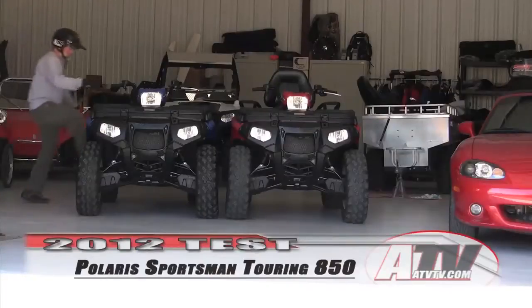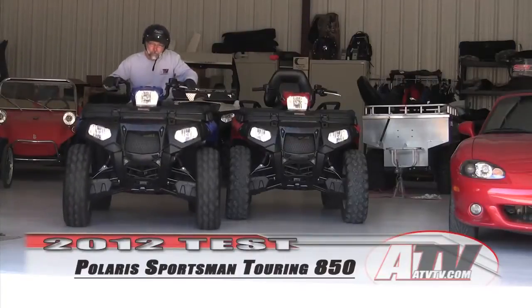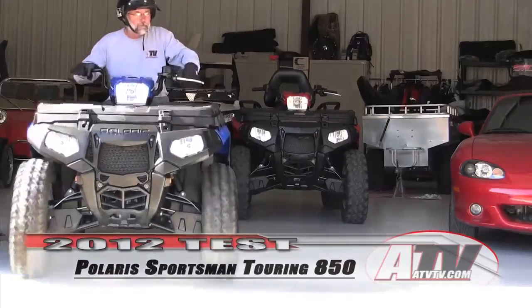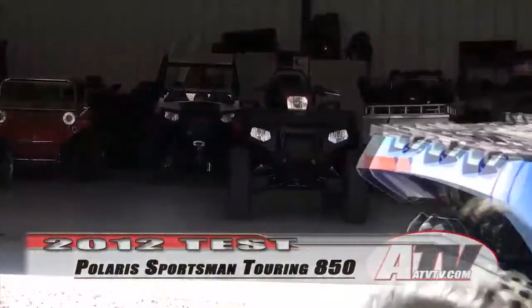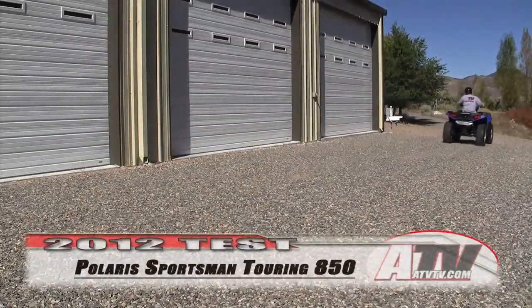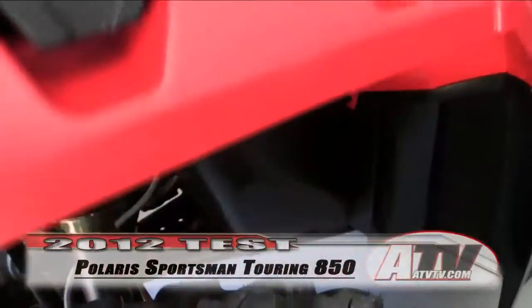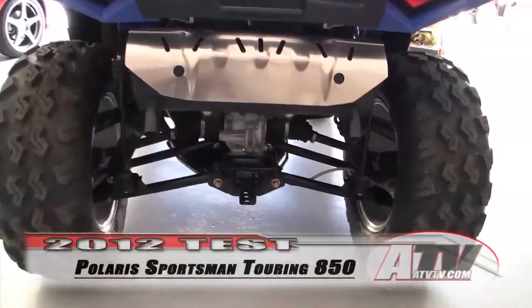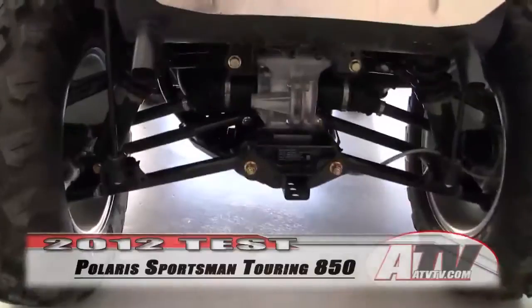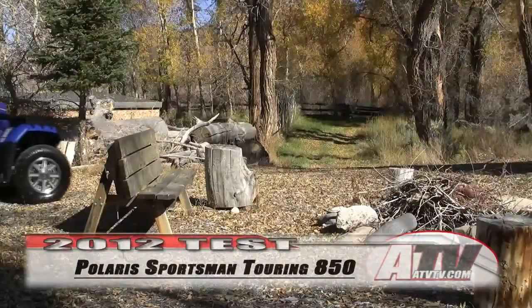The Sportsman XPs were first introduced in 2009 and gave the Sportsman several very important new features. One is the new longitudinal engine and the CVT transmission that made the whole ATV much smoother in its operation. Now, also helping to make the XP feel more stable was the repositioning of the fuel tank lower into the frame. The handling was also much improved with a change to an A-arm design on the front and a revised rear suspension.